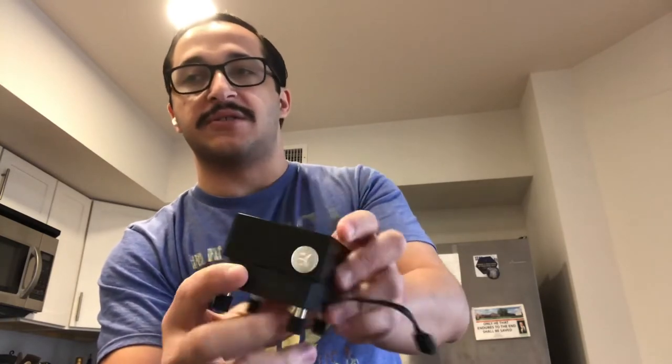So here you can see there's no screw access to the pump, so I'll show you how to do that. Also, don't bother with taking this. This is a glorified sticker, and there's no screw behind here. So first, what you want to do is unscrew these rubber feet off the bottom, and these help reduce vibrations, so you don't have the pump rattling in your system.